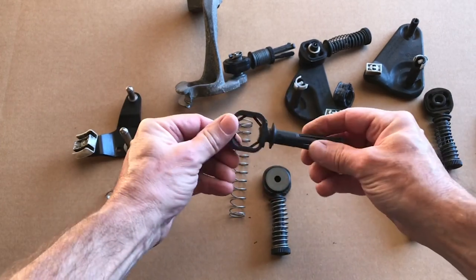It looks like there's a problem with the side-to-side adjustment because when I push down it didn't really want to line up. Open that cable end again, give it a jiggle — it was probably just a little too aggressive with my pull back. There's actually a little bit of slop baked into this factory box, so just give it a jiggle and let it float freely. Then check again: first, second, third, fourth, fifth, sixth, down into reverse. At this point, if you've got all your gears and can engage them smoothly, you're done. If not, go back and redo that adjustment.